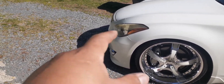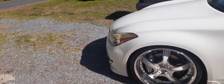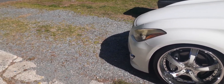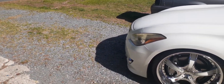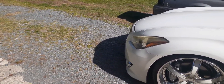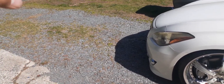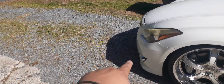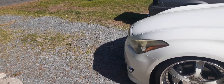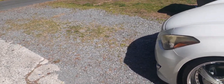Visibility is 100 percent better, especially with the fogs. I first adjusted the fogs up to the bottom of the beam on the wall, but it was too high — people were flashing me like crazy. My wife confirmed when I turned on the fog lights they were brighter than my high beam. So I brought them back down to where the light kind of just fades out from the headlight beam, and nobody's flashing me anymore. The road is lit up from one side to the next.